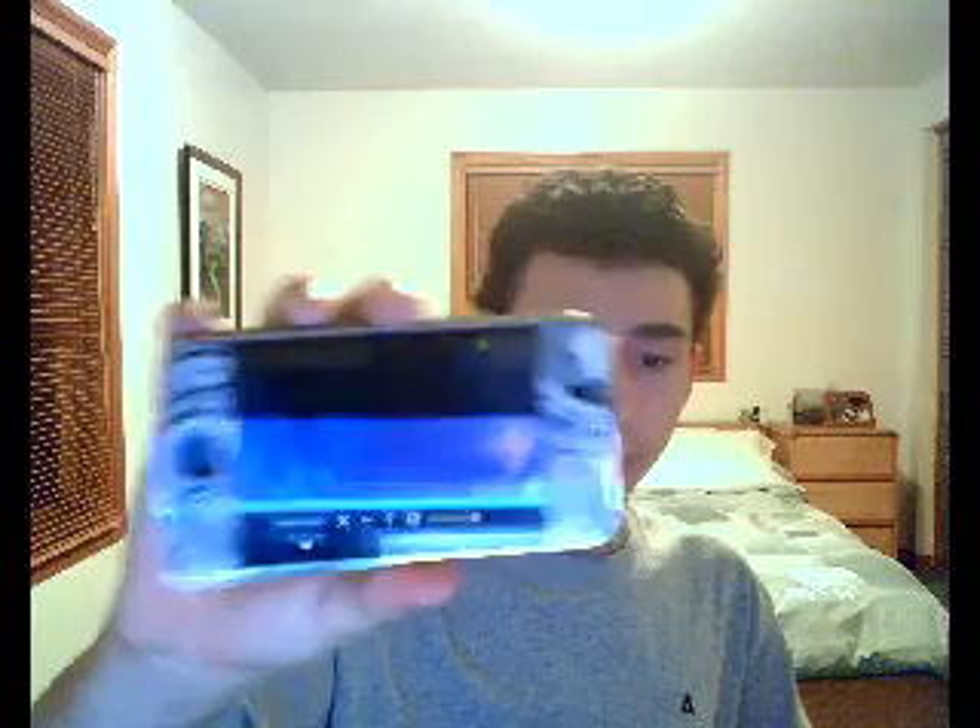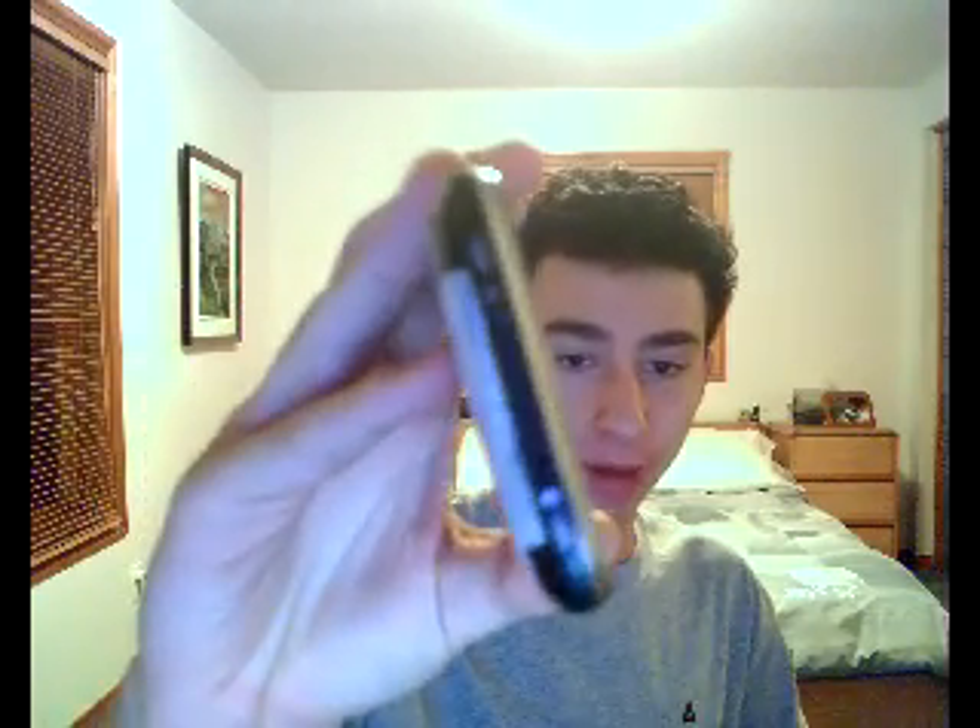To start opening up the iPhone, you'll see the iPhone really has no other screws except at the bottom here. You're going to notice two screws, so you're going to need a little screwdriver that fits them — one there. You're going to find two of them right beside the speaker and microphone. The first thing you're going to want to do is unscrew those. Make sure you don't lose them. I'm going to put mine right here in a little cup. Unscrew these and just put that aside.